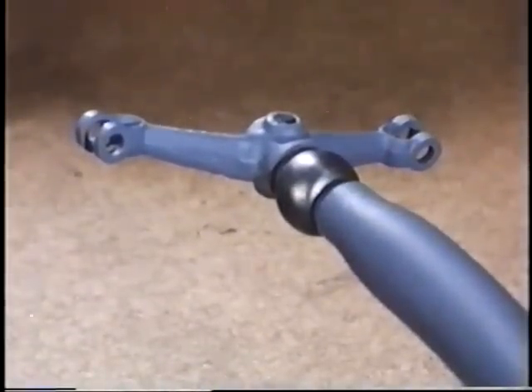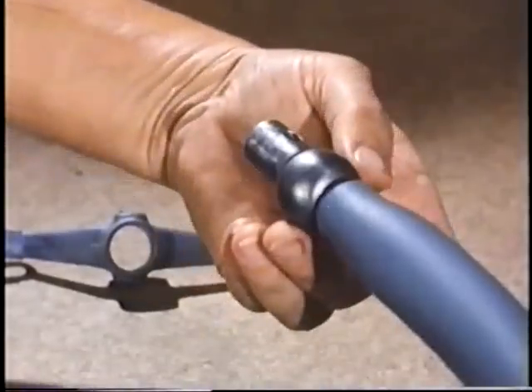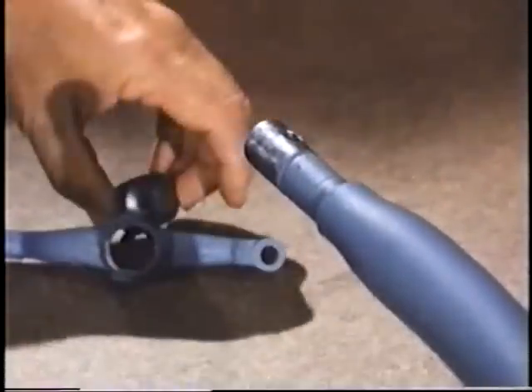Let's talk about the service brake cross shaft. Almost all unrestored cross shafts will have wear and unwanted play at the bearing ends. The cure is to renew the shaft ends to the original size and replace the worn bearings. This is a machine shop job, and unless equipped, the average restorer will probably send this work out. It's a simple operation: the shaft ends are built up with weld and then turned down to fit the lever.